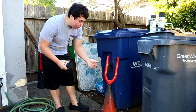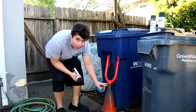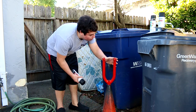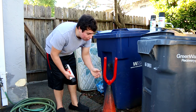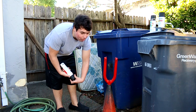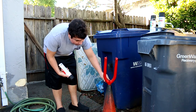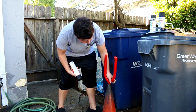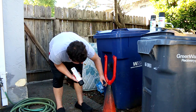The next part is getting your part in a safe spot to paint. You're going to want to either hang them or find something you can put them on that won't tip over, so you can paint the whole thing at once. For forks, a traffic cone is the best thing to do because it holds the steerer tube in the hole and stops right at the integrated spot.